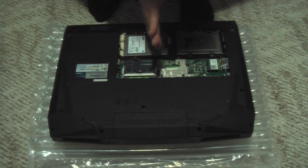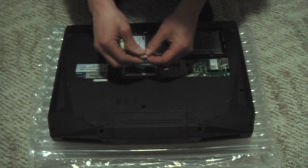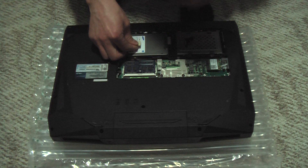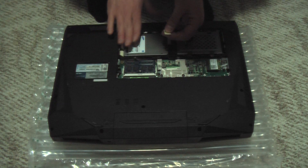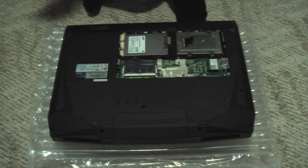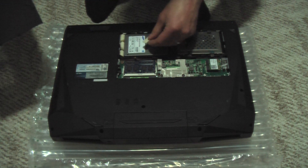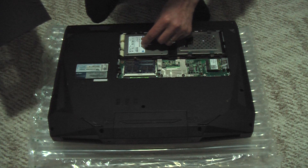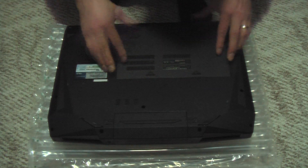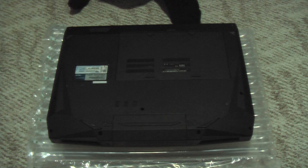Those will expand to push the drive in and keep it secure into the connector side. I'm going to take a fourth one, pinch and flatten it, and put that on top so that when I put the cover down it just puts a little pressure that way — just so it's not going to fall out. They don't expand that quickly so it's not a big deal. Put them there and screw the cover in.